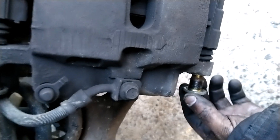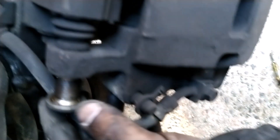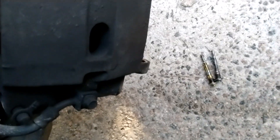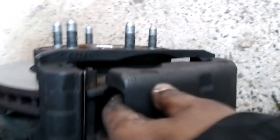These are the two caliper bolts. Once you break them loose they come out — just pull them out like that. That's the lower one. There's the top one; you break them loose then just pull it out. The thread is only up here so once it's broken loose you just pull it out. Those are the two bolts that hold this caliper. Now this caliper will come off. Get a screwdriver and pry the caliper out. The caliper is now loose, just being held by the tension of the brake pad.